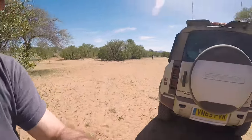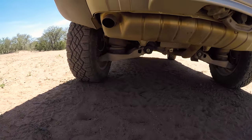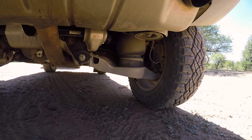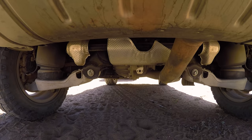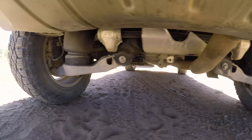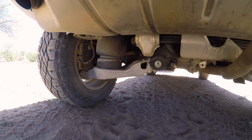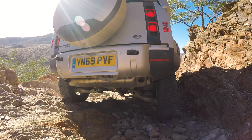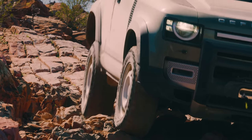Because it's an off-roader, there is a standard spare tyre, which is good and easily accessible. But what that necessitates is a door that opens sideways, because you can't have a rear tailgate that opens up if you've got a door on it. While that doesn't keep the rain off you while you're putting your wellies on, on a proper off-roader I think that is not a bad idea. While I'm underneath, you can see an air spring. What's also visible is the independent rear suspension — you can see the suspension arms hanging lower than they would with a live axle, where you'd just have the diff in the middle and a straight run across to the wheel.